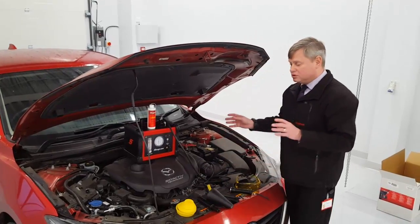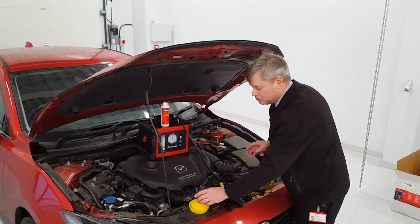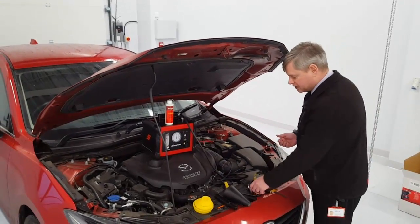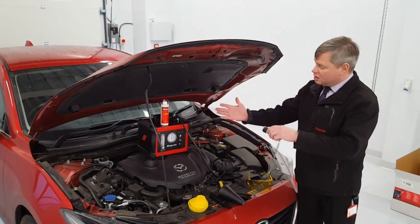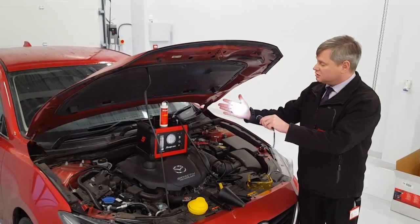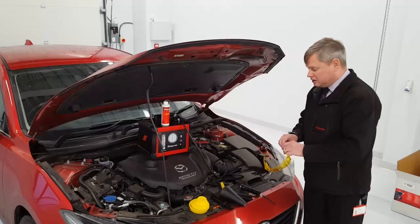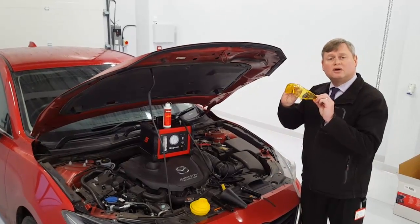When we're testing components of the vehicle like a turbocharger intercooler unit, we also have closing plugs so that we can shut off the outlet side and inject the smoke into the input side. To help us identify the smoke, we also include a multifunction torch which includes a red spotting light, a UV light, and a white light, all of which help to identify the smoke and the UV dye escaping from a leak on the car.